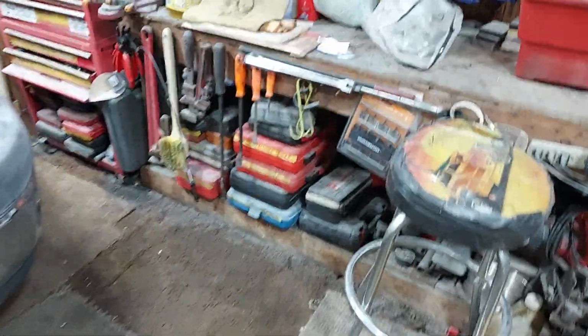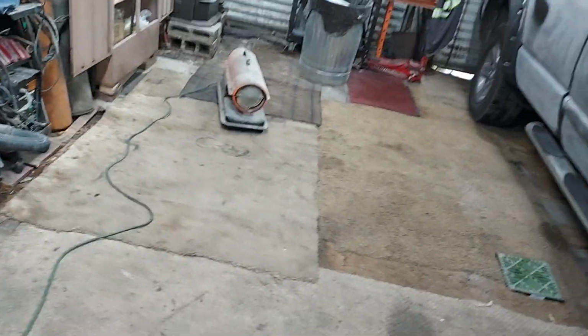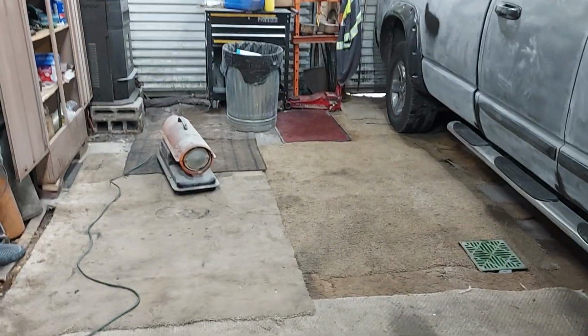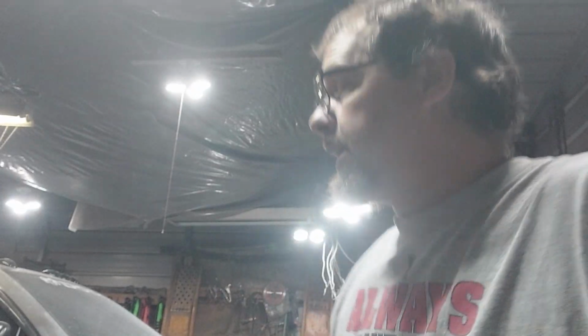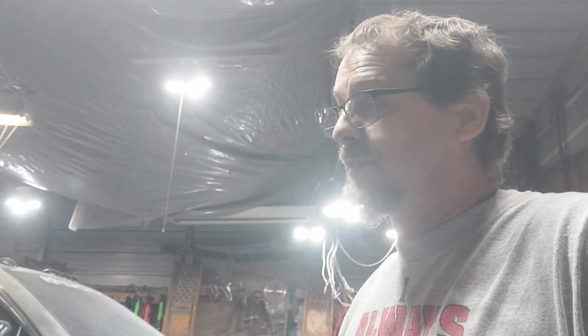Like I said, once it's done, I'll post a video of that, show you what it looks like, probably Tuesday or Wednesday, because tomorrow I got a car I got to bring in. I got to wet sand and buff it. I got to buff it with 3 different, man, I can't think today. I'm losing my mind. Compounds. I got to go with a rough cut, and then a medium cut, and then a swirl remover polish. And that's going to be probably a 5 to 6 hour job.